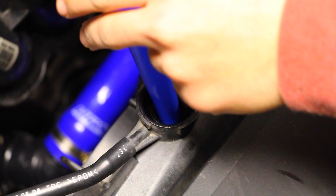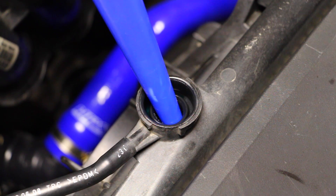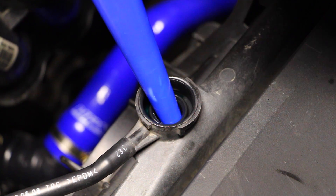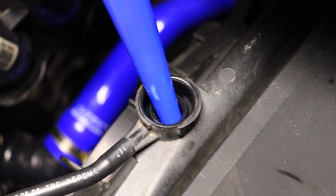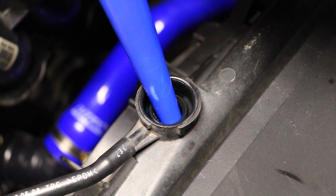As for the coolant I'm using today, I'm using a pre-diluted 50/50 mix of OEM Honda Type 2 fluid. I'll have links to whatever kind of fluid you're going to need in the description box so if you need coolant I'll have some there for you to pick up. Just take your time with doing this — you don't want to overflow it.